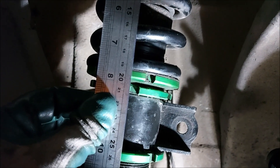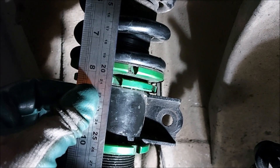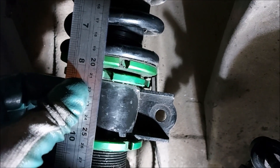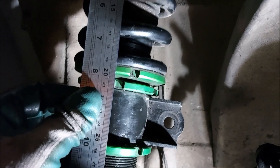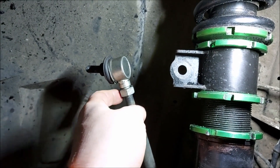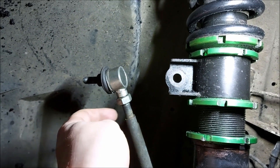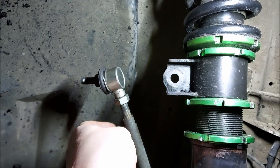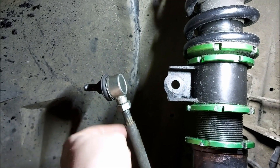I've just double checked that both sides have got the same spring preload - I've measured both sides from the plate at the top and they're both exactly the same. The driver's side drop link undid alright, but the passenger side just won't come out of the shaft. I'll have to remember to put a load of copper grease in next time to see if that helps.